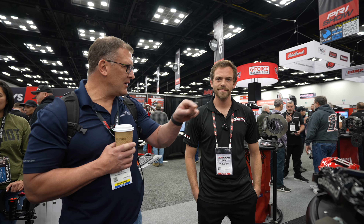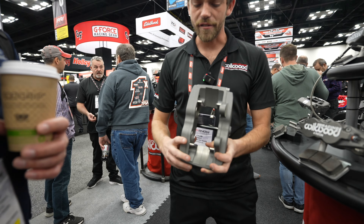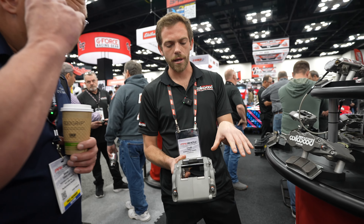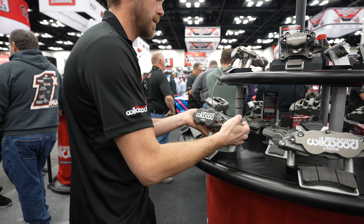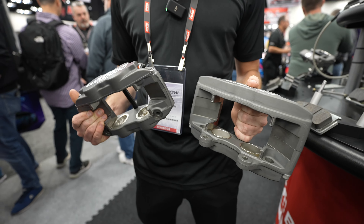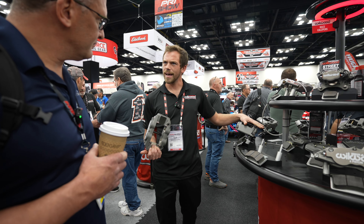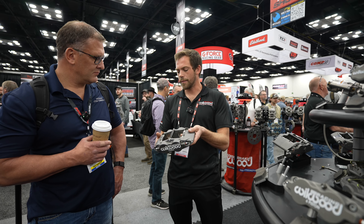We can go through the progression of the Superlite over the years. This is our tab-mount Superlite, a very popular caliper for off-road racing, street car, and circle track applications — a tab mount with a 3.5-inch mount center and multiple rotor thickness and piston size options. The step up over the years was moving from a tab-mounted design over to a radial-mounted caliper. Both have very similar body shapes and take the same brake pad, but the radial mount moves the mount height further up toward the caliper body, which increases stiffness and reduces flex. We've been making the Superlite at Wilwood for about 45 years, constantly updated from cast to forged, removing spacers in the body, and now with radial-mount and upgraded Therm-Lock pistons — a dual-shell design to prevent heat transfer into the fluid and caliper body.